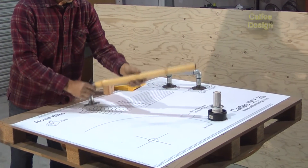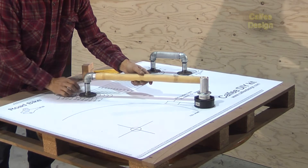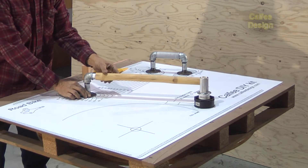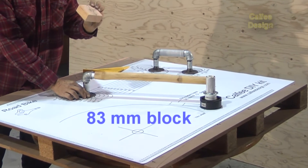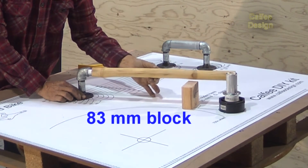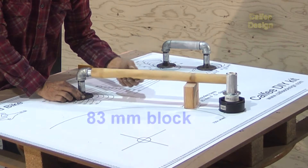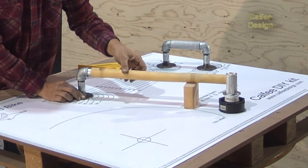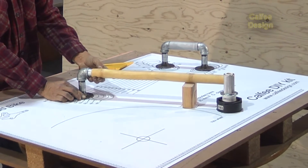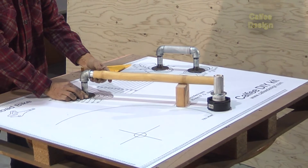We'll hook that up there and line that up. I'm going to rotate this to where I like it — I think I like it about there — but I have to make sure my 83 millimeter block will fit there, because that is very important for proper front derailleur performance. So if I turn it the wrong way it jacks up a little bit, so I'm going to keep it nice and then decide: do I want it this way or that way? I think I want it this way.